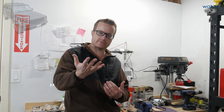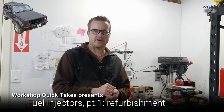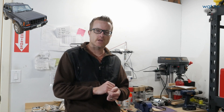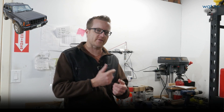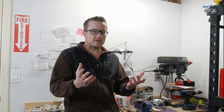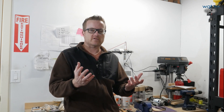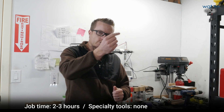Hey everyone, welcome back to my YouTube channel. Thanks for joining us again on Workshop Quick Takes. We're going to look at fuel injectors in our 2000 Jeep Cherokee XJ. Most people don't think of fuel injectors as regular maintenance items, but sometimes they need replacement or the tips need to be soaked to remove excess varnish buildup. Today's maintenance was inspired when we wiggled one of the fuel injectors and fuel wept down the side from the top of the rail.